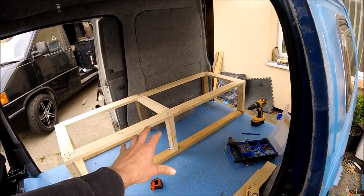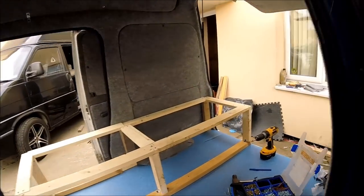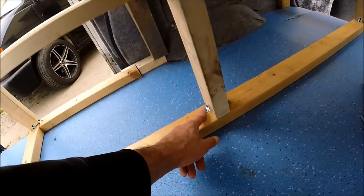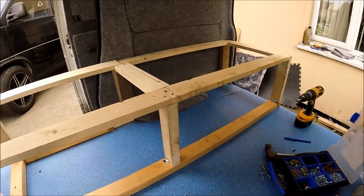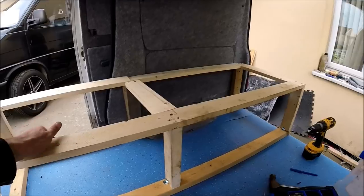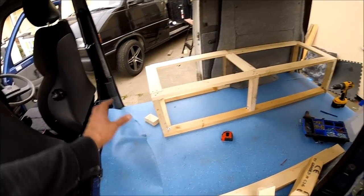There's the basic frame pretty much all done. I've still got to do the side bit that's going to go along there, but it's just the same rinse and repeat — just chopping little bits here and there, fettles here and there if you need to. It's a very basic frame as you can see, just a big sheath for strength and support. It's secured all the way through the ply floor. These little brackets I'm actually going to change over — these are just the only ones I've got to hand — but looking at this when I'm shaking it, the actual van's shaking rather than the bed moving, so that's already secure.